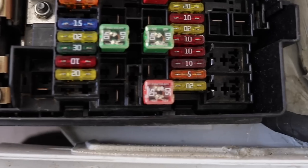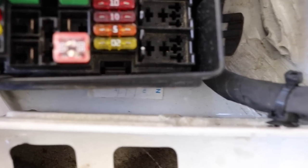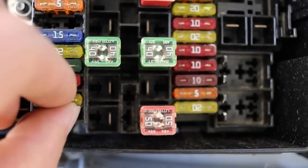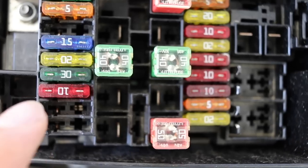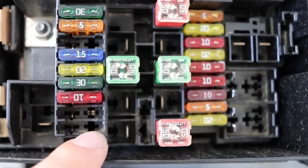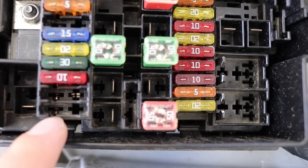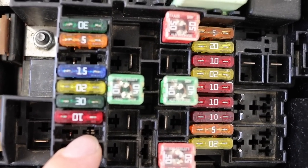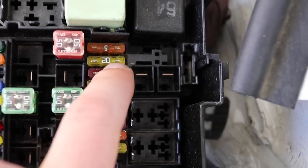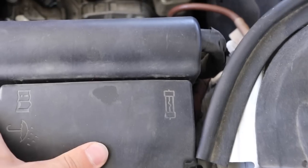Since we're on the subject of fuses, here's what I mean. You can tell if a fuse is supposed to be somewhere — if you pull out one of these fuses you'll see two contacts, one and one. That means a fuse belongs there. If you don't see any contacts, generally there's not supposed to be something there. But if you see two contacts, a fuse should be there — that's what I found was missing, causing all the headaches.